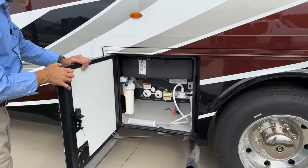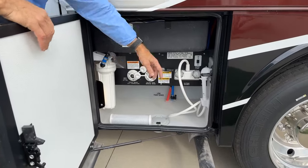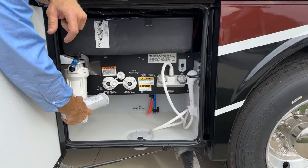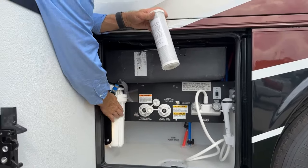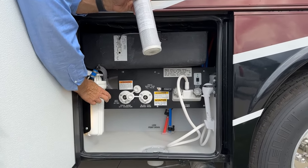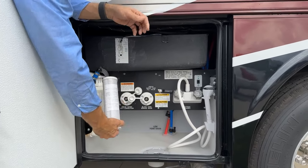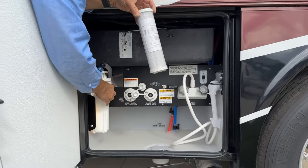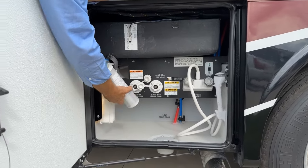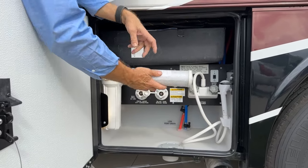This is our wet bay compartment. Our wet bay compartment contains the house filter wrench we saw earlier inside in the kitchen drawer area to remove this cover and insert the filter. You'd use your wrench here and loosen this and just drop this in and put this back and retighten. So that's your whole house filter.